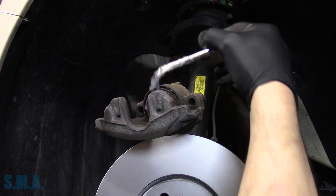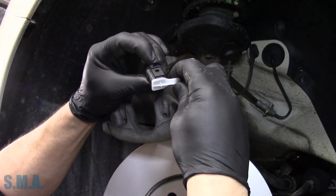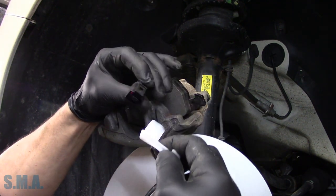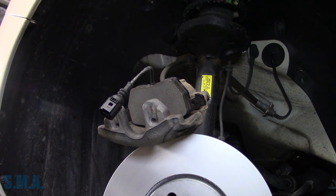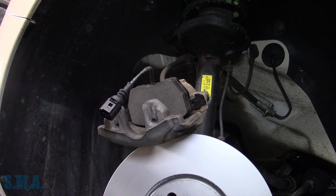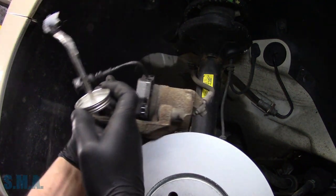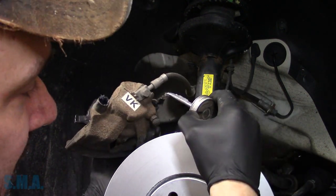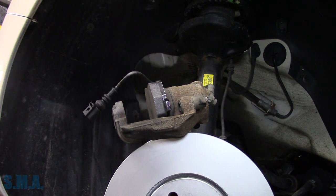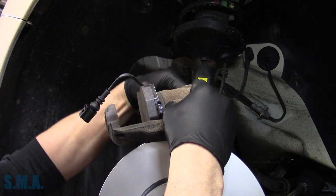Put a little silicone grease on our piston. We'll click our inner pad in — it's got a little protective thing, and it actually had a latch on it, so push the button next time. Didn't break anything. On our outer pad it has some adhesive — peel that off. Once we put the bracket in, we'll stick it in the bracket and then stick the caliper on. I'll stick a little bit of silicone grease in the slider pins — these are moving pretty freely.